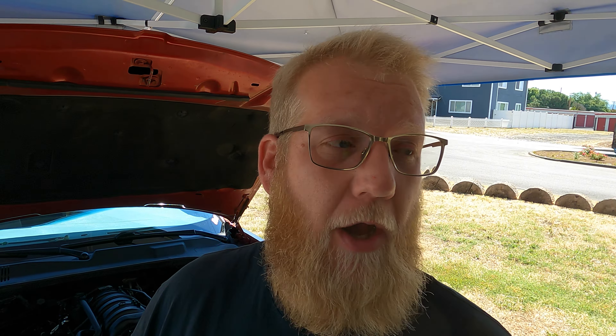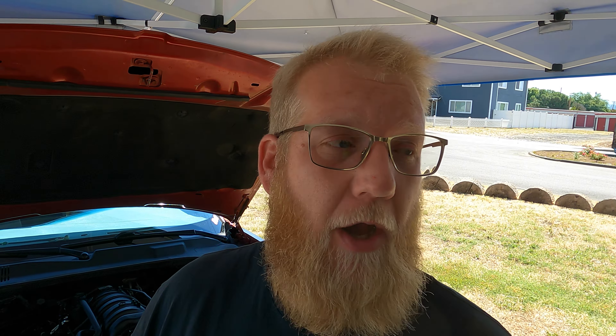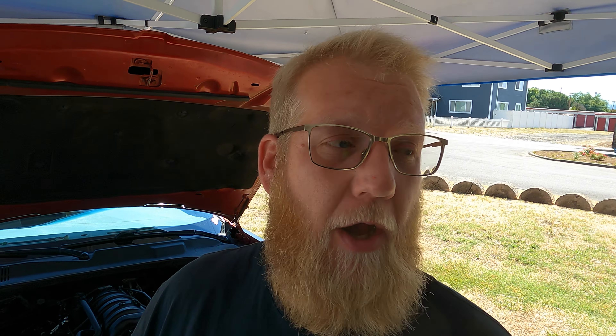These new motor mounts are not going to work at all. Pay attention to what you're buying. These are actually different heights even. First, the obvious issue — these studs are longer than these studs, and they cannot stick past the base of this flange, because then they'd run into the frame. I could cut them, but then look at this shoulder right here — it's like twice as thick as the brace it's going up against, so the nuts aren't going to tighten all the way down, or they'll strip out half the nut going in. That's no bueno.